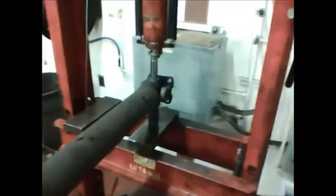So we completed burning our injected plastic out of the yokes to release the universal joints. We're going to use the press for the rear universal joint. And you can see what we have is a socket, and it's pressing down on the upper cap, and then we have another socket that's wider than the cap supporting it. Okay, and it's mounted up in the press.